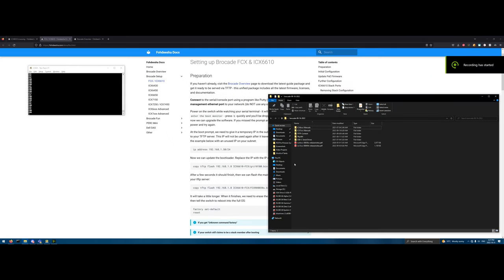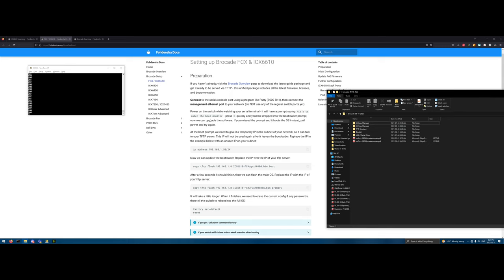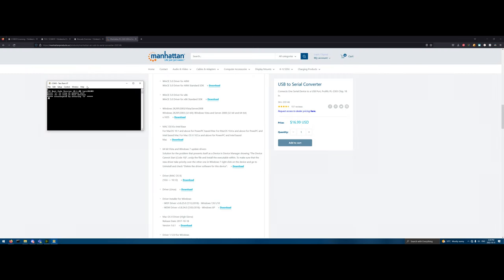Okay, so we've got it hooked up. Hopefully it's working fine with the Cisco serial cable. I am getting stuff over the serial management board, but I'm going to reboot the switch, and we'll see if it actually does properly do this. Oh, you know what? That is the serial port, the USB one, for my custom volume control knob. Alright. I gotta get some drivers on. Hooray! Helps if you actually plug your adapter in while you still have a network connection so you can get drivers.